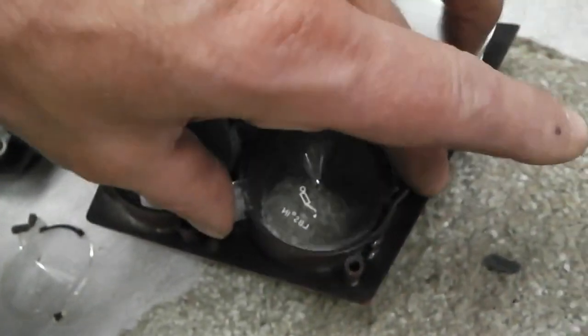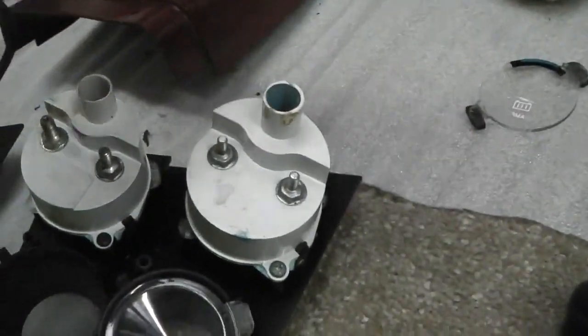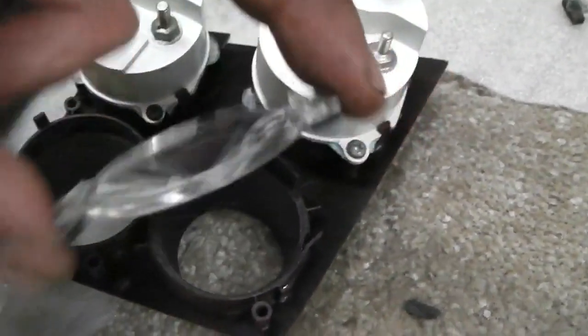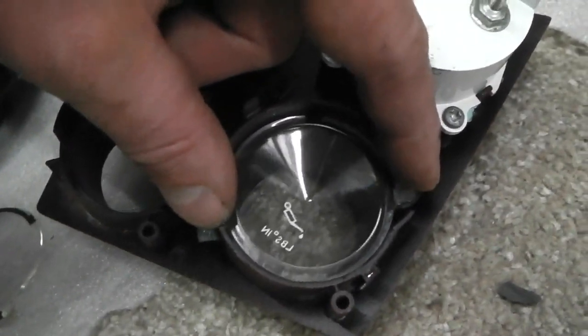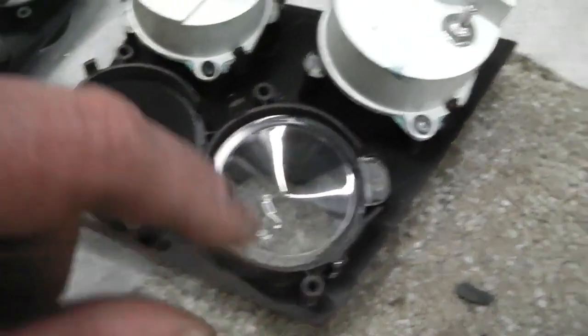Then later on, there was an intermediate design, similar but totally flat, similar logo. Then I think they changed it yet again to slightly larger dial faces. But the way that it is at the moment, we've got the oil pressure gauge here going in, cleaned up, and then just on its locating tabs, you'll see I put little foam pads there. Now that stops your faceplate rattling and creates a sort of push squeeze fit there. You need those, so we're going to put that all together now, get the back on there.